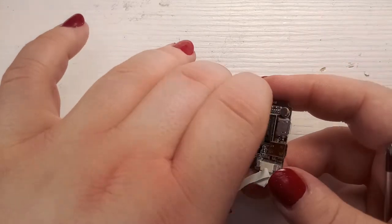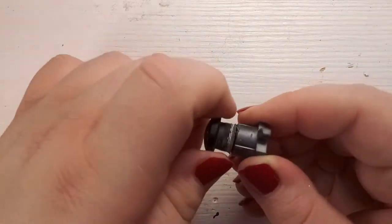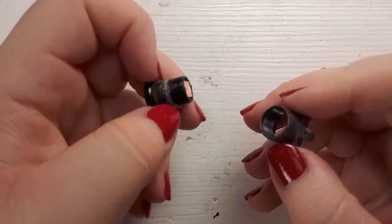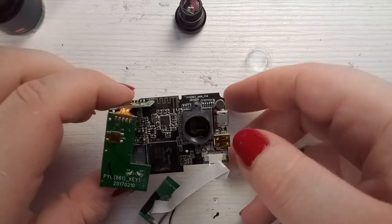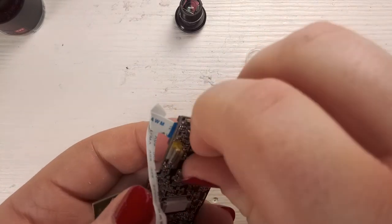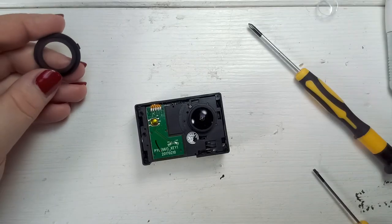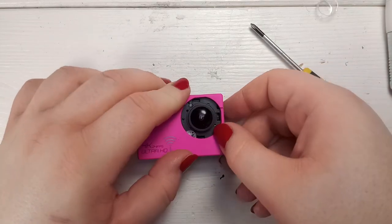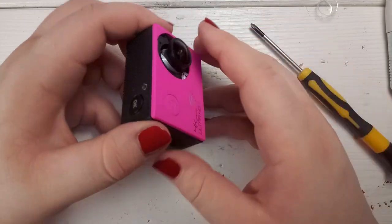At this point I recommend removing the lens holder with the lens still stuck inside. After it is unscrewed, be careful not to touch the camera sensor and don't get dust on it. Now you can unscrew the lens without the risk of damaging the camera. Afterward, set the lens holder back into place and screw it in. I highly recommend you reinstall the lens during reassembly to protect the sensor. Put the coloured front plate back on without the black plastic part that would normally go around the lens — this creates more space for aftermarket lenses — and then you can finally unscrew the old one and install the new lens.